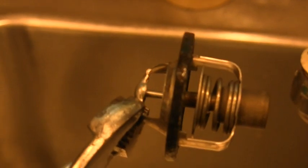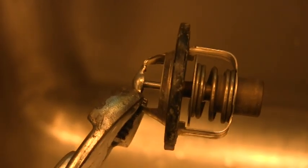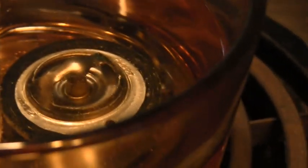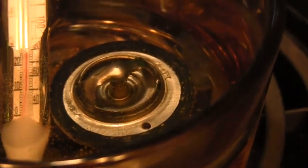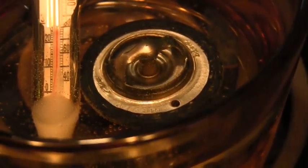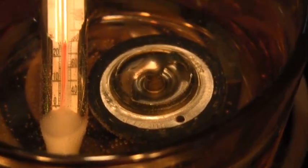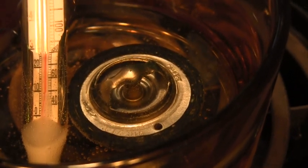You can see the plate right there and it measures more than eight millimeters, so it is fully opening. I'm going to turn the heat off now and let it cool down to see if it will close. The temp is under 160 — about 158°F — and it's almost closed. I guess I wasted a lot of time and pulled a lot of parts off that I didn't need to, but now I know. It was just one other thing to try to figure out what the issue was — so the thermostat was working adequately. But I think I'll still buy a new one.